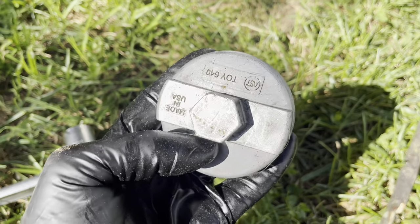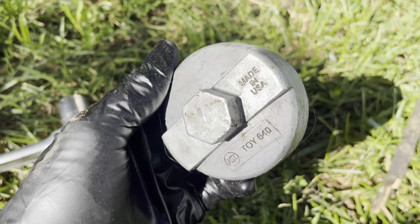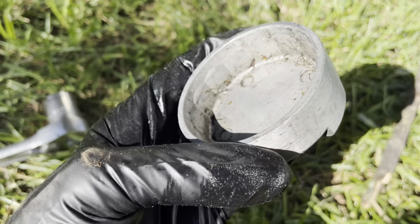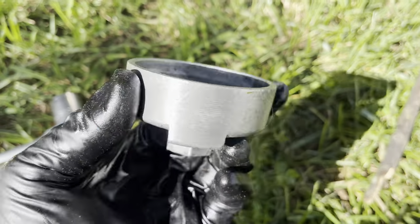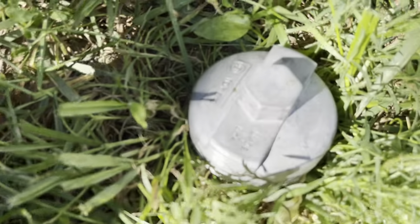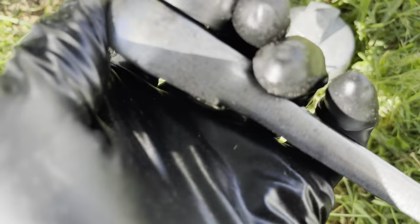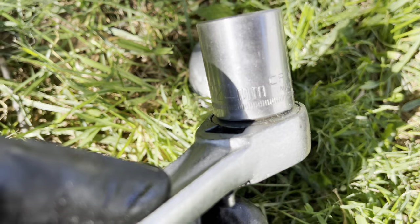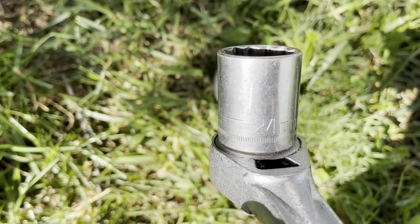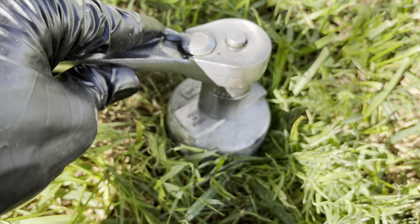Here's how you get your oil filter off. You need one of these filter cap wrenches — I got mine online, there's a link in the description. This goes over the filter cap to loosen it — you're loosening the cap, not the actual filter element. I think it's a 24 millimeter — yeah, 24 — it goes right over the top, and then you loosen it like that.